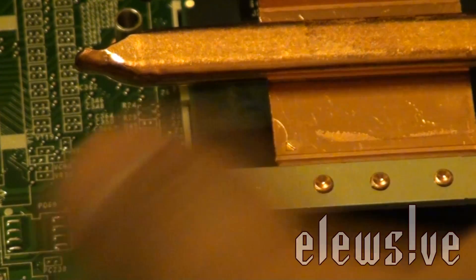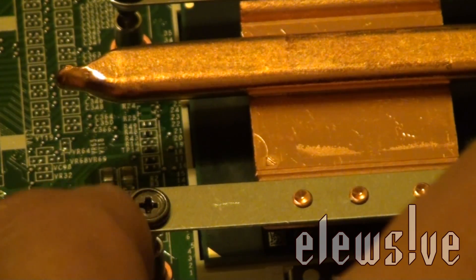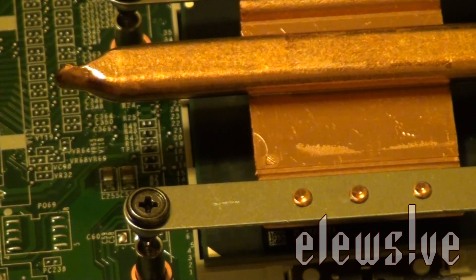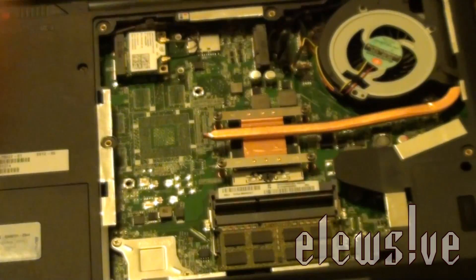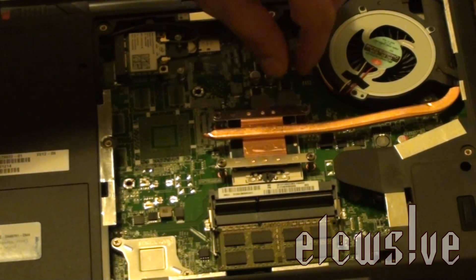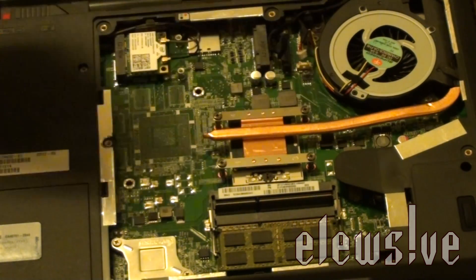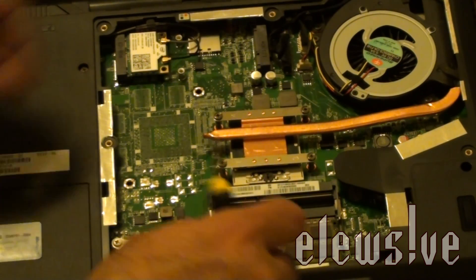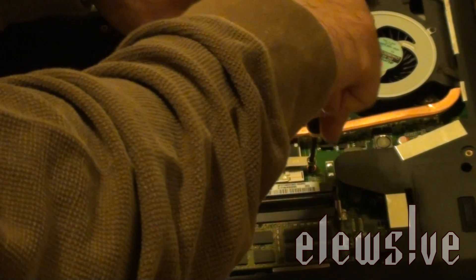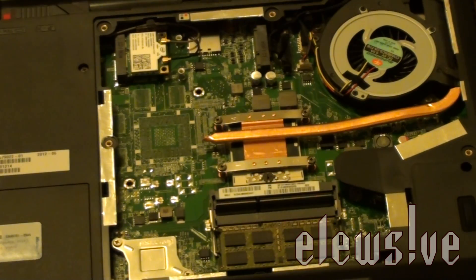At this point I am going to seat this back into place. It looks like almost everything is good, and I need to make sure everything is aligned. I will be doing one screw first — one side screwed in. Now I just need to do the second side for the fan assembly, and I think we are good. Also you have to connect the fan. Now we're going to put in the fan — these little jumpers here only go in one way so you should be fine. Now we are going to secure the actual heat sink. We're going to put one side in, make sure and tighten this even more. That's what it takes to add the processor into the main board.